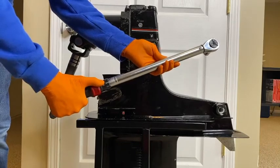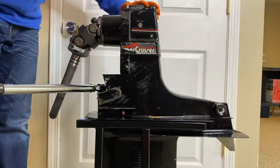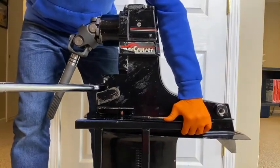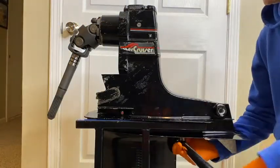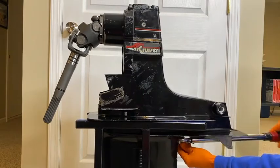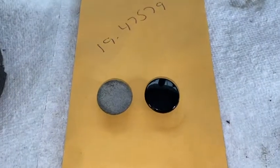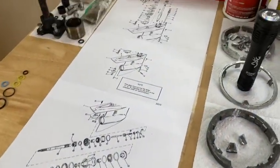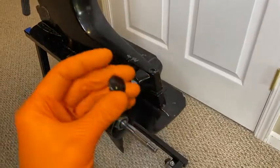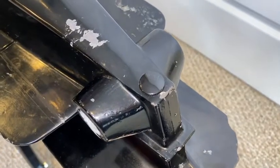Back to the workbench — now it is time to install the new cap. What a difference! Back to the outdrive, here is that bolt we had to install prior to connecting the upper to the lower, and our brand new cap. Align the plastic teeth properly and just push it in place — that looks a lot better. Now I'll slide the propeller on flush and rotate the yoke shaft while testing forward, neutral, and reverse to verify that the propeller is rotating correctly. In forward it rotates — good. Shifting to neutral, it should not move — good. And reverse — good. Also check for clearance between the propeller and the brand new anode — not an issue.